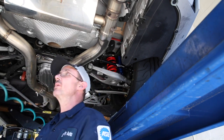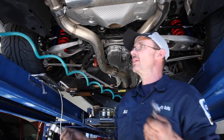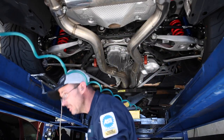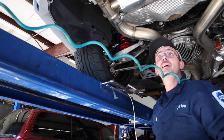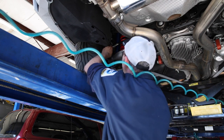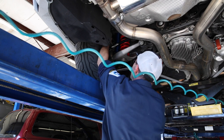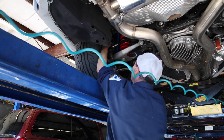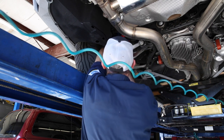Now, theoretically, you only have to remove one side. You don't have to unload the sway bar the way you're doing all four, just to make it perfect. Well, apparently I've been driving without a front sway bar for a long time, because the front end link was broken. Really? Hanging there, yeah. Because the spring perch for the front coilover was misaligned. Got it. So it yanked it out.